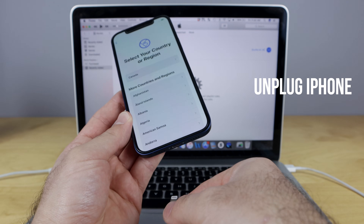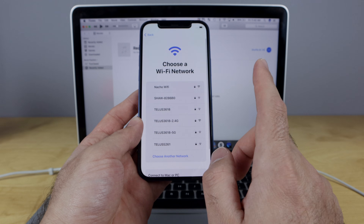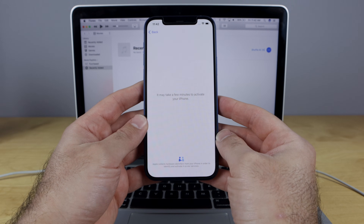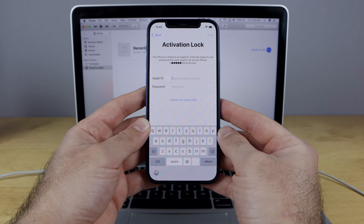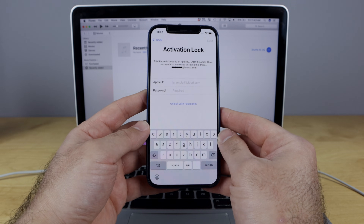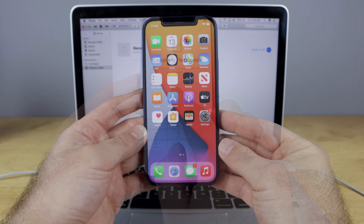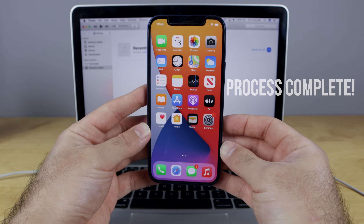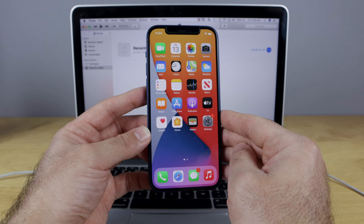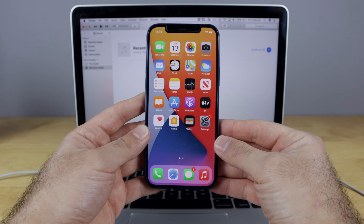You can now unplug your phone — you don't need to leave it plugged into your computer. I'm going to set up manually and show you where it tells you to log in to your Apple ID. After connecting to Wi-Fi, it says it's going to activate the phone. Here is the activation lock — you'll have to enter in your Apple ID username and passcode to continue with the setup process. Once you've entered your correct username and password, you can continue setting up the phone. And there we go — the phone is now completely factory reset, fresh from the beginning. It's like a brand new phone, and that should correct any sort of software glitches, freezing, or battery life issues. If this video was helpful, let me know in the comments section below, hit the thumbs up button, make sure you subscribe, and I'll catch you guys on the next one.